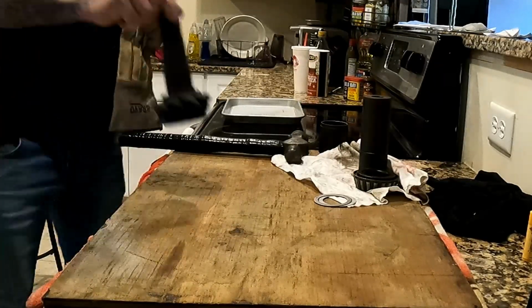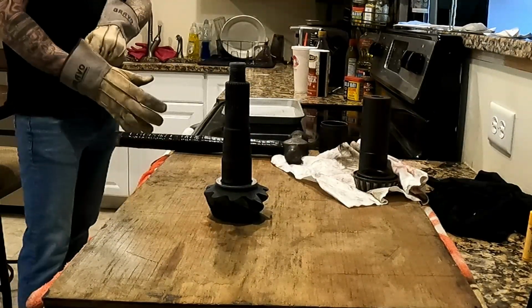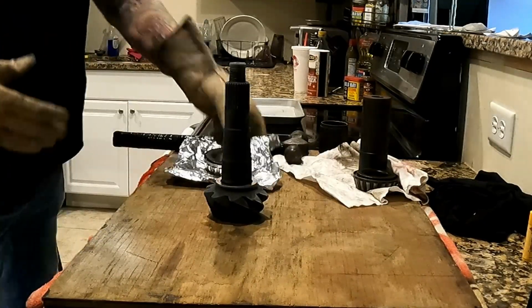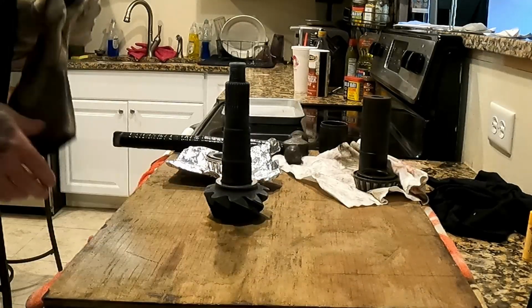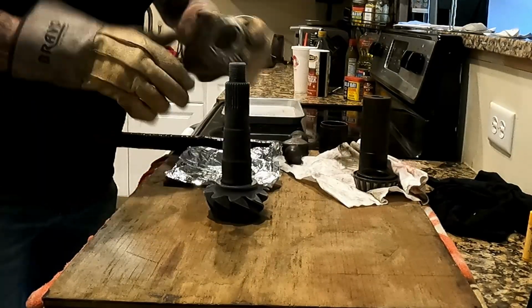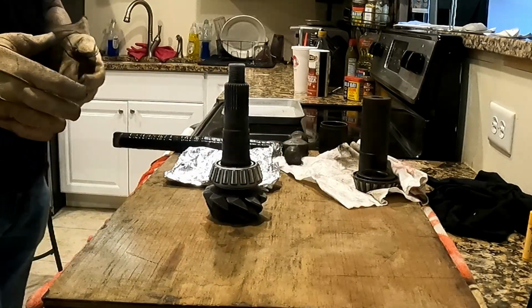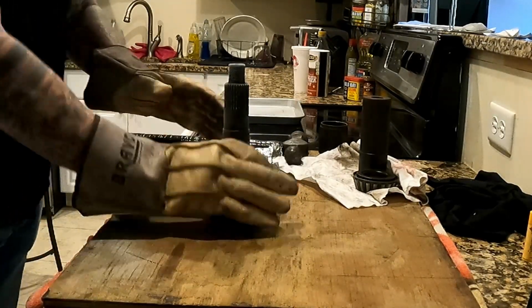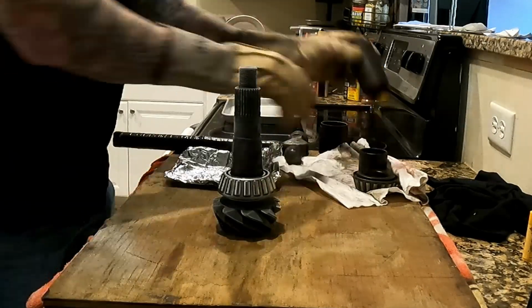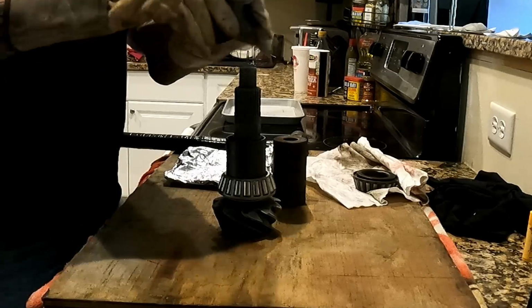All right, pinion gear out of the freezer. Check your shims on. Grab that bearing out of the oven. Freezer, oven on the bearing. Boom. That easy. It's all the way down. Shims are crushed, and then you can always just follow up and make sure that it's seated.